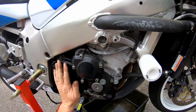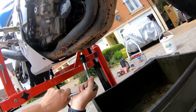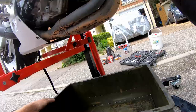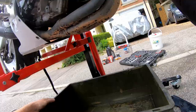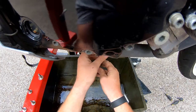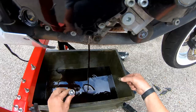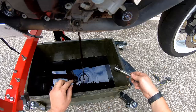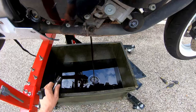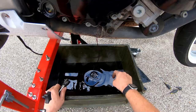That's plenty of warmth in the engine now, that should make the oil nice and runny. So next we're going to crack off the sump bolt which is just here — 21 mil socket. Make sure you've got a good oil pan to catch it all because you don't want it going over your garage floor. Drop it out just like so and recover the plug from the bottom of the pan. It's not red hot but it's nice and warm, so it's nice and runny.